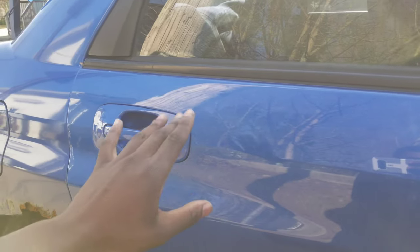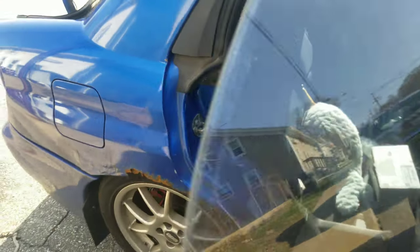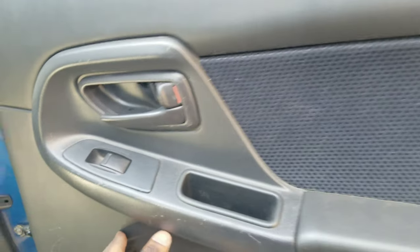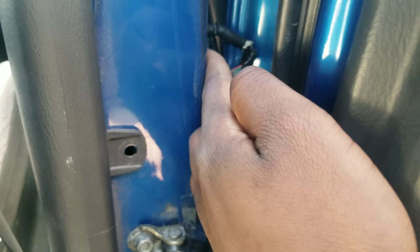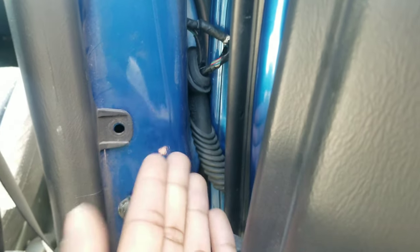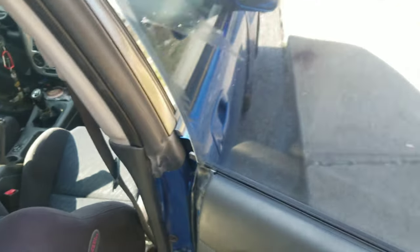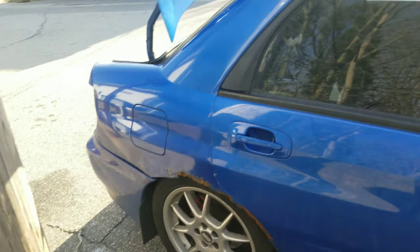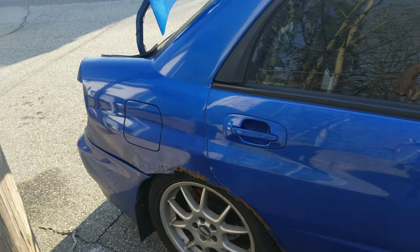This is fine for right now because it doesn't look too out of place. For the back door, it's actually an '06 door — the only thing that was a little bit of a pain was taking off the door panel itself and then changing out the harness. On the '02 to '03 they have two plugs — one white connector and one cream connector — but on the '04 and up they just have one singular connector, so I had to change out the entire harness. It wasn't that crazy, just a little more annoying than expected, but everything lines up and we're gonna get that fixed ASAP.